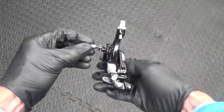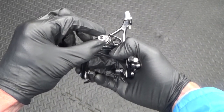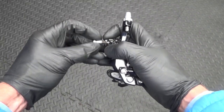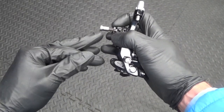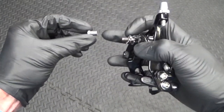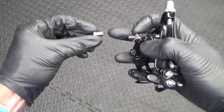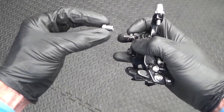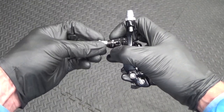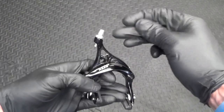You've got the mounting bolt on the back — normally a 5mm on the back. It depends if you're fitting it to the front or the rear what size nut you would have, so the length of that nut with the smooth shaft on it. If it's for a front brake it'd be a longer version because it needs to go through your fork; on the rear maybe a small one like this, just depending on what frame you've got. So that's normally a 5mm there.